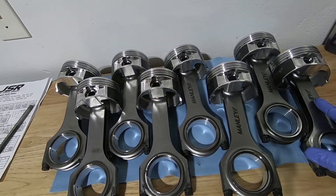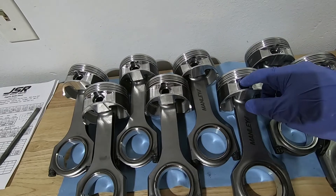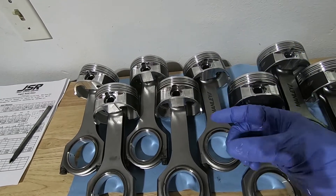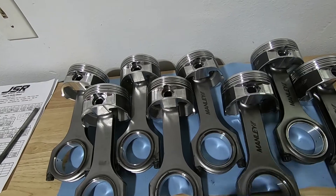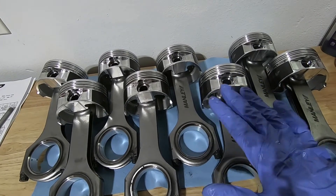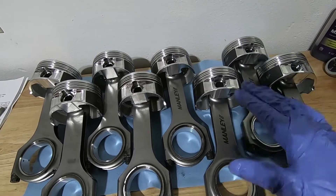Now that all the pistons and rods are mated to each other, one thing I really want to stress is to make sure that you get the C-clip down in the groove. I have seen engine failures due to the C-clip — they used to have spiral locks in these things and there were two of them. I had an engine come to me where the customer brought in a spiral lock and asked if it could be part of the failure — it had come out of the oil pan. So that will definitely cause an engine failure. Just make sure that you get all your C-clips seated properly. They only come with the right amount you need, so if you have one left over, go back and make sure you're not missing one. If one shoots off you're going to have to find another one because they give you exactly enough to do eight pistons. We'll see you next time. Thank you.